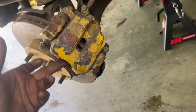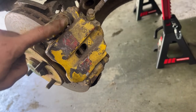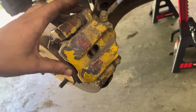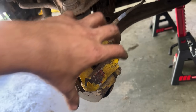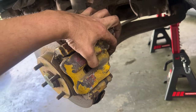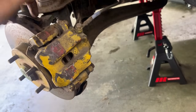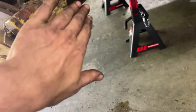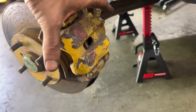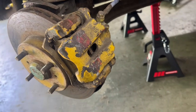The idea is, first of all, to change the brake pads, but second, to make sure that right here these bolts are actually long pins that travel inside the caliper carrier. We have a bore inside and that travels back and forth, so this entire part of the caliper moves back and forth relative to this part. So this way we achieve pressure on both sides of the disc with just one cylinder. When this cylinder presses here, that pushes on this brake pad on this side, but of course it pushes itself away from the disc, and the motion of the caliper going that way is what pushes on this brake pad. So that's pretty smart, because the old style calipers had two cylinders on both sides, so they can push on both sides. Here we achieve pressure on both sides with only one cylinder. You understand it?